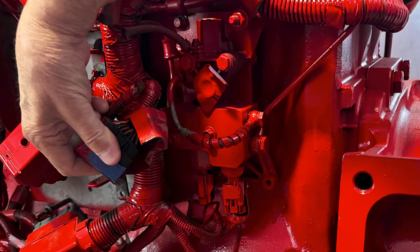The injector will pulse — pulse that injector when it's ready — and then if we have an exhaust leak we see what looks like whitish smoke coming out of the leak puffing out, and it changes at different rates because the ECM will change the duty cycle of that injector that's behind the turbo.